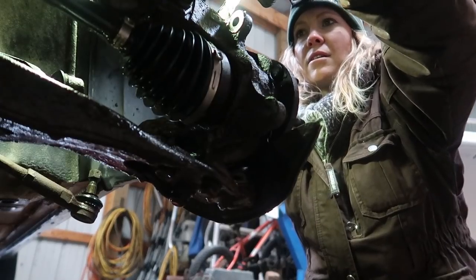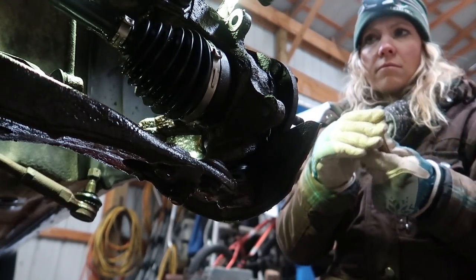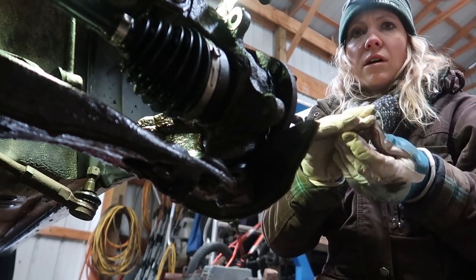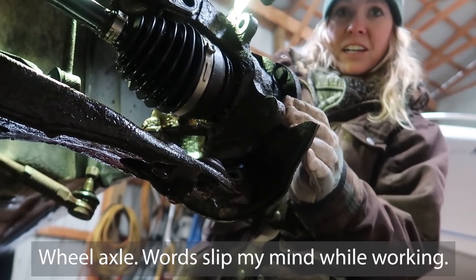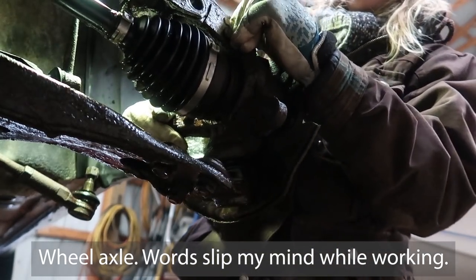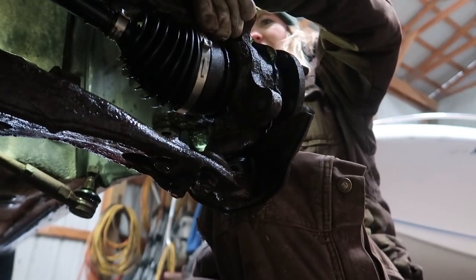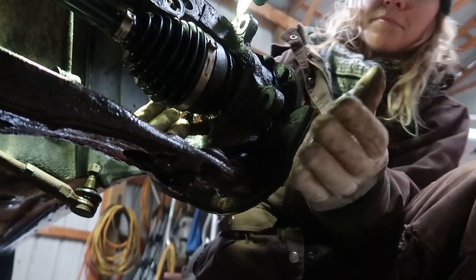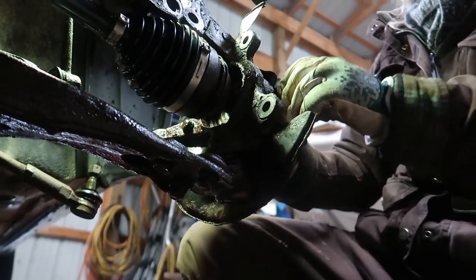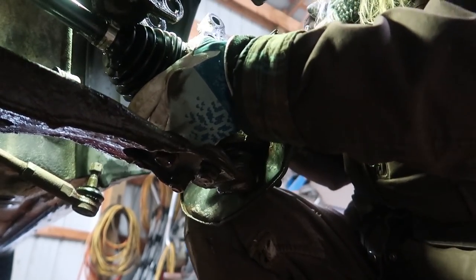These four nuts and bolts are hand-loose up here. We've got both our nuts - setting those aside. The ball joint actually feels like it's pushing out, so I might be able to just pop it off. It's really rusted. I put my knee here just in case. And there it is - pushed right out. I did not expect it to press out so easily. I figured I'd have to whack it out, but it's like 'okay yeah, let's get out of that sucker - give me a new pair of shoes, mom.'